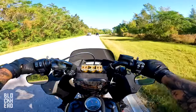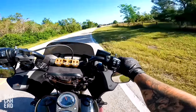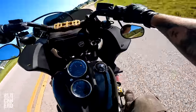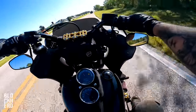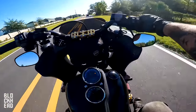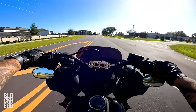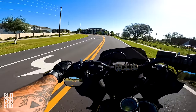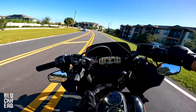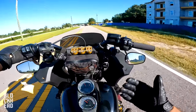I didn't expect a ton more power because we didn't change the heads, but we do have heads from Zippers Performance specifically made for the cam we have — the S&S 590 race cam, incredibly high-lift — which is why in the upper RPM range this bike performs incredibly well. The HPI tunnel ram looks great and has gotten a lot of questions online and in person. The performance is what we were mostly focused on. We're modifying this incrementally so we can see whether each change dramatically increases power and is worth the bang for the buck — and yes, it is.